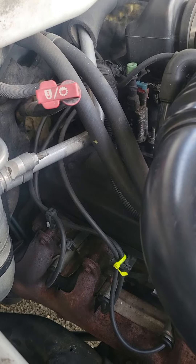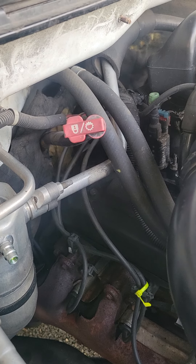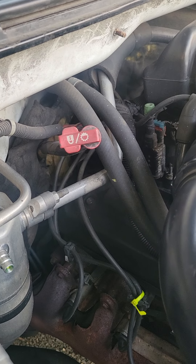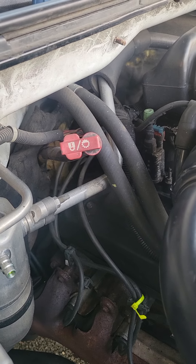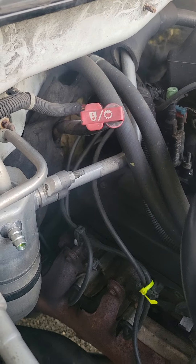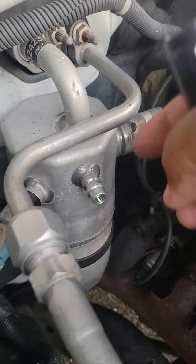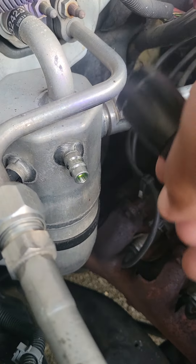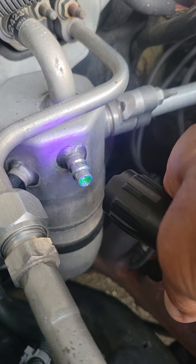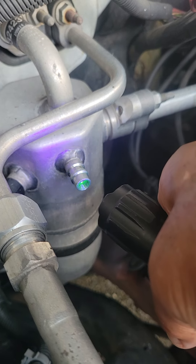For those of you with cars where your AC compressor sits down in some dark hole, get your UV light when the engine is cold, go down in there and look at every single connection running to and from the AC compressor. Look at the AC compressor itself. With your UV light running everywhere, notice what happens when I run it over the low side service port — see it glows. When you find your leak with your UV light, it should glow just like that to let you know that's where your problem is.